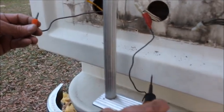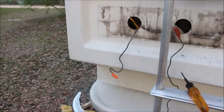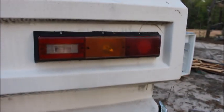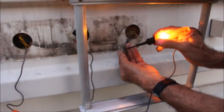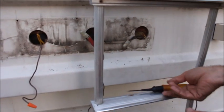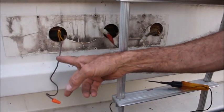When I had the light switch pulled out, the left blinker would not work, so I've got to figure out why the left blinker won't work with the light switch pulled out. I'm going to see if the right blinker works with the light switch pulled out. Okay guys, we're trying to figure out which one is the reverse light - we've tried them all so far with no results on the other lights. This is our reverse light right here. We've got them all figured out; we just need to work out the deal with one wire being both a tail light, turn signal, and brake light simultaneously.